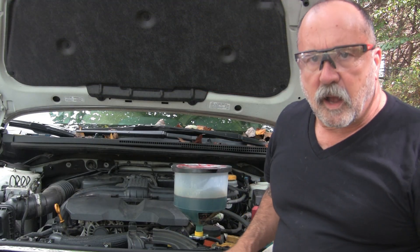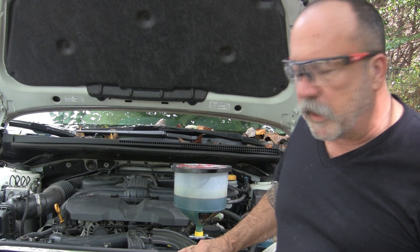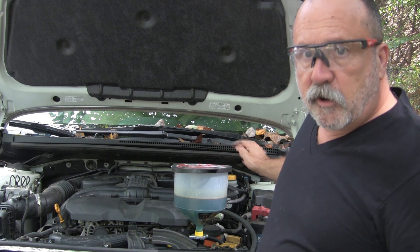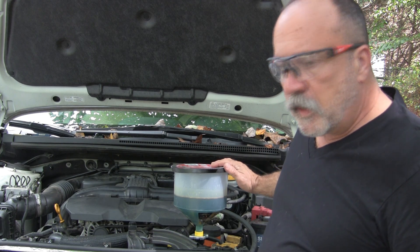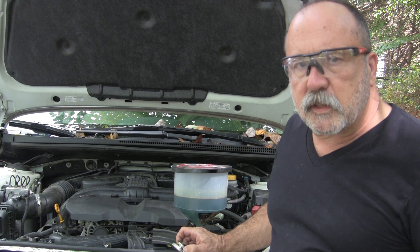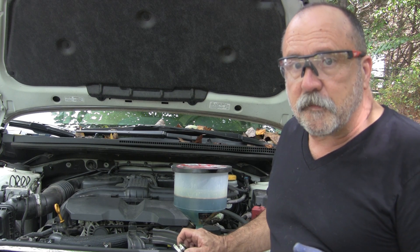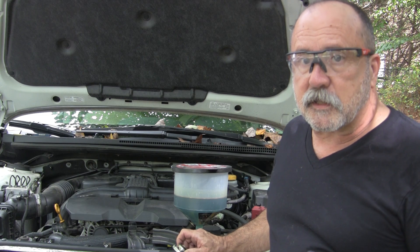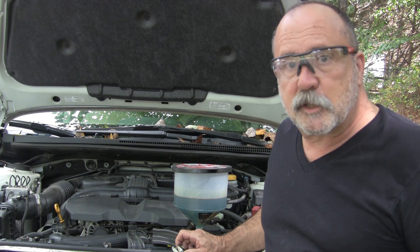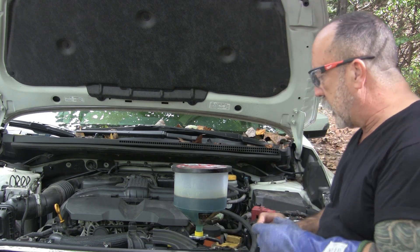It's not burping anymore, but what I'm going to do while the engine is running is take this off, plug it up, take it off, put it in the overflow container, and quickly put the cap on. The reason I'm doing it this way is that while the engine's running there's no back pressure. If I turn the engine off there will be back pressure because it's at operating temperature and that fluid's going to expand. Let me go ahead and get that done quick.